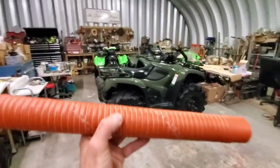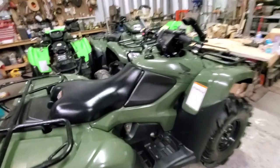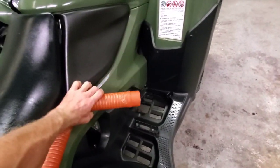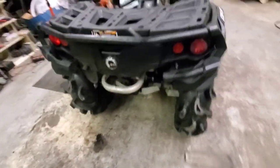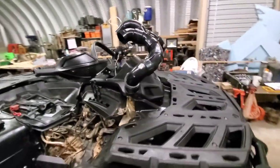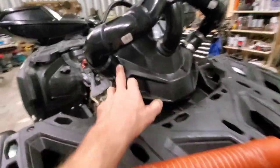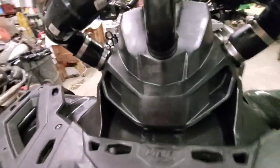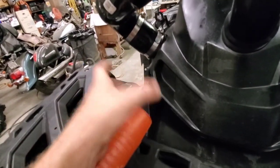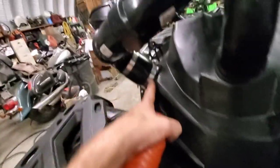On these Hondas I ended up using it from the air box to the two-inch snorkels because it was one and a half inch before. All up under here is this orange stuff — you flex it where you want it, zip tie it in place, and you're good. It just snakes right over the intake and comes right out here. I used a street fitting, and right over the tip is the black ABS two-inch with a 22-degree angle coming out.